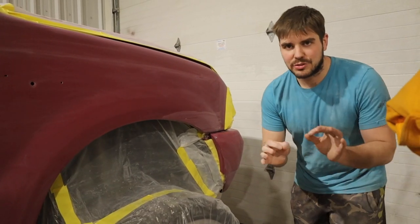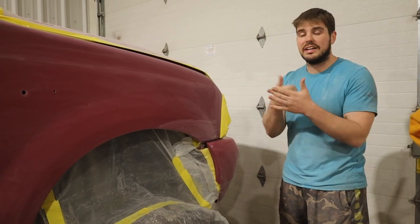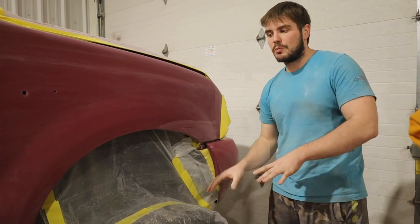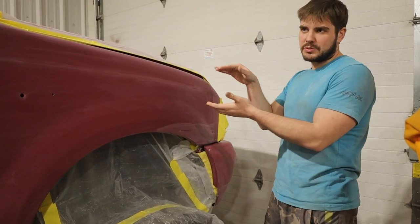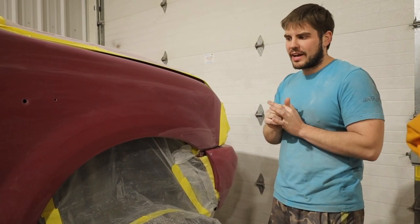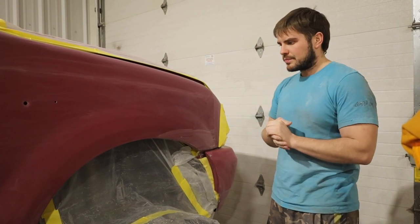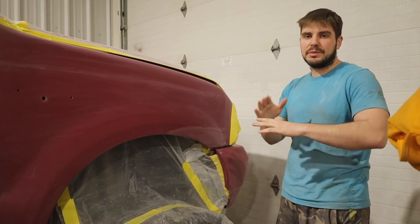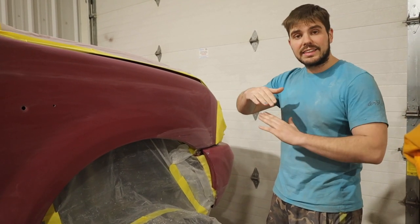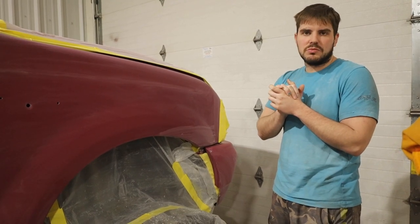There's one thing I absolutely hate, and it's rubbing. When you turn and it clips a fender, it clips a bumper, it clips the liner, it clips plastic. It drives me nuts. Originally, this setup was chosen because this thing was gonna have a 2-inch leveling kit on it. Well, at the time, I got a drop shackle, and I should have went with the actual leaf leveling kit for this, because then it would have fit. That drop shackle, on a normal truck, would kick it back enough and all the angles are fine, but if I kick that thing back right now, the drive shaft just would not have it.